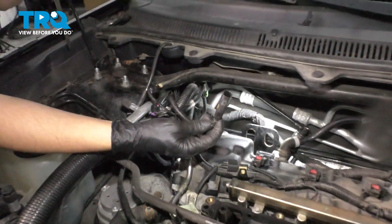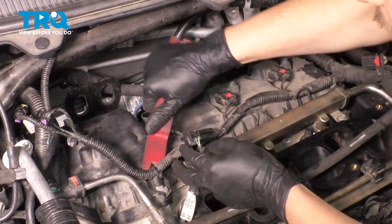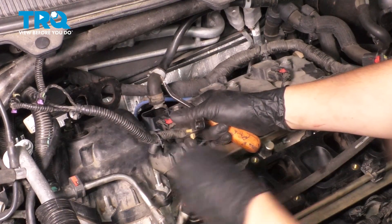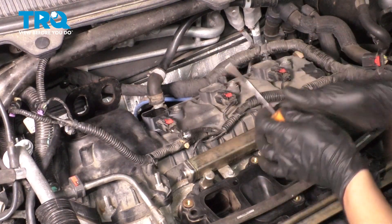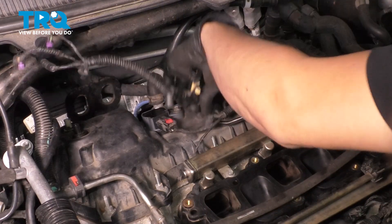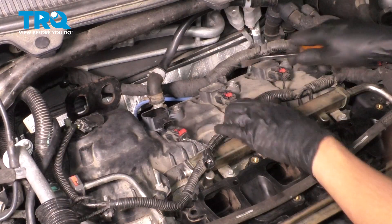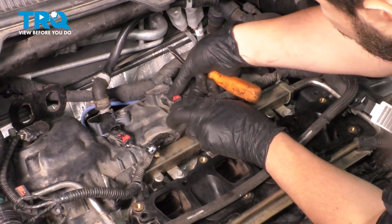There's the connector — it popped off. Now let's disconnect the harness from the retainer on the stud — try to get something in here and pry it up and off without breaking anything. A lot of times these are very tight. Continuing down the line — unplug the coolant temp sensor connector and tuck it out of the way, then keep popping this harness off the retainers. We'll need access to all these studs. Let's unplug the ignition coils: pry the locking tabs back a little bit and then press the connector to get it off. Do the same down the line — be careful not to pry too hard or you'll break them.